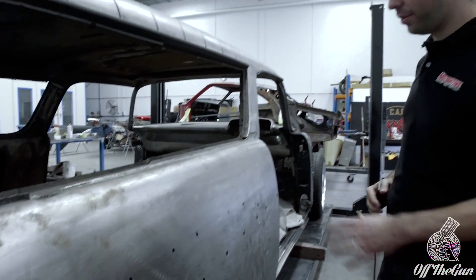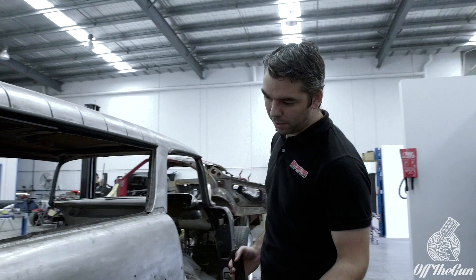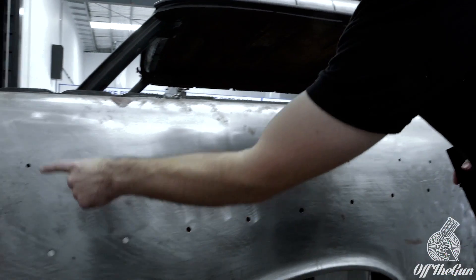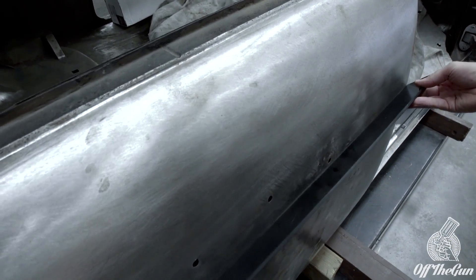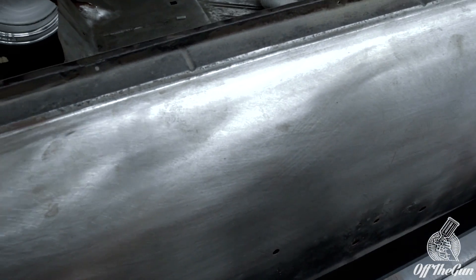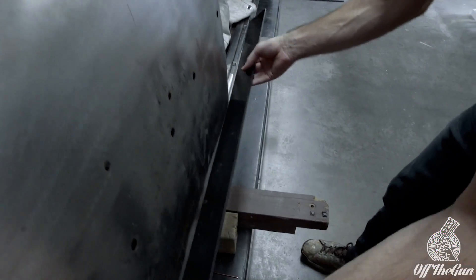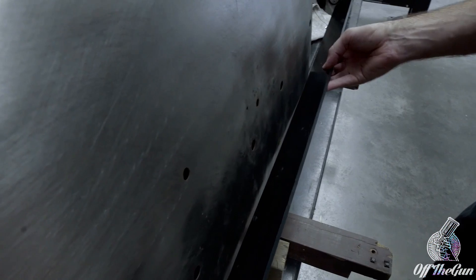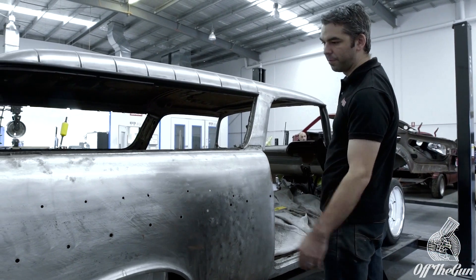We've just done the other side of the Nomad — the rear quarter is looking pretty nice, nothing too major picked up. We've jumped around the other side out of curiosity and we can see there are a lot of hammer marks, welding marks, grind marks, and a lot of shrink marks over this area. This side of the car has clearly had a lot more work. We'll drop the spline over this side — you can see right over the top, looking down, the rear quarter should be a nice fluid line but there's a significant low area. It's almost 10mm deep in the worst area — you wouldn't really want to load that up with filler. So we've picked it up, it needs to get pulled out. Luckily we caught it and the guys can do the metalwork before they break this one for paint.